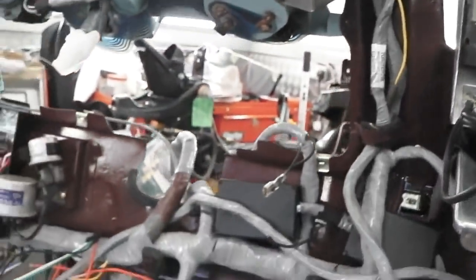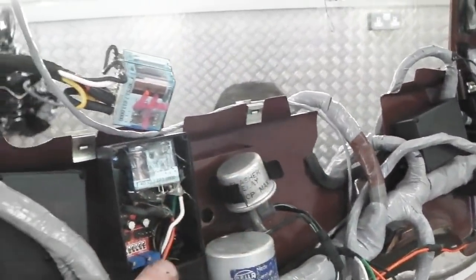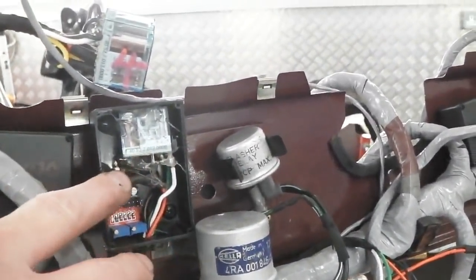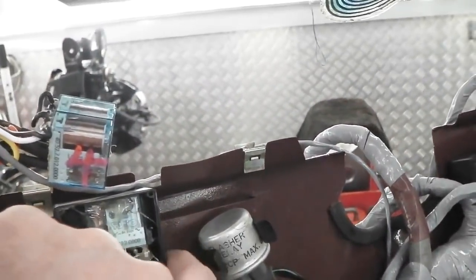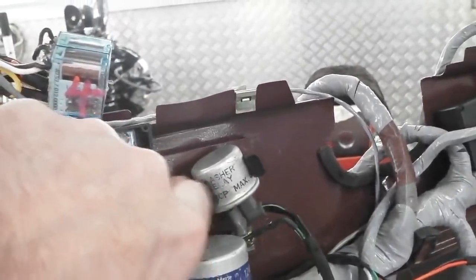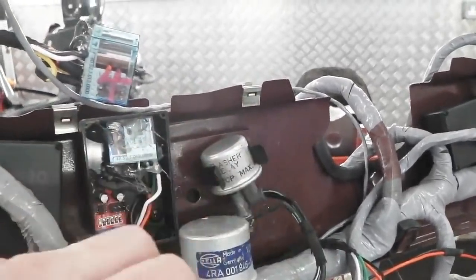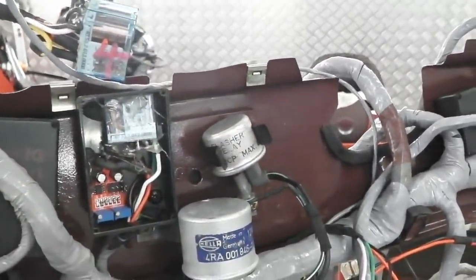Down we go and down we go. And around. Heated rear relay, flasher relay, hazard relay that we built. Now, we missed the build on the hazard relay. It hasn't got its lid on just yet, but we mount it to the sounding board. It's not really a sounding board, but it acts as one for the flasher to make the resonating noise, so you get it echoing and you can hear it in the car, because not only does it actually flash the lights, but it's audible too, and it's designed to be audible. And you get that nice pinging sound with these. We'll show you that later on.